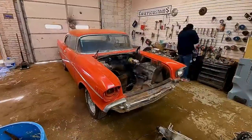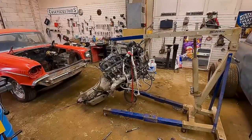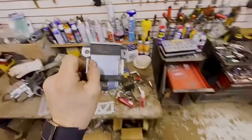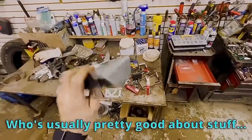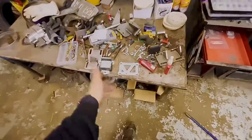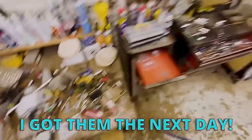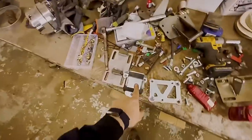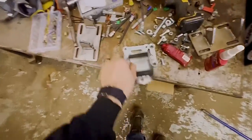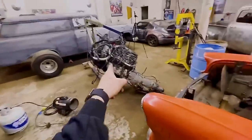That's one problem fixed. Check it out — great news. I reached out to the company, it was Speedway, who's usually pretty good about stuff. I said I only have this mount, and they said I should have also got this adapter plate. I looked everywhere and I might have lost it since the kit's been sitting around so long. But they threw these in a box for me and I got them the next day — super happy about that. I already put the passenger side on. It's actually kind of cool how it works — they use a small block Chevy base mount and then an adapter plate for LS bolt holes. Kind of genius.